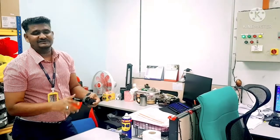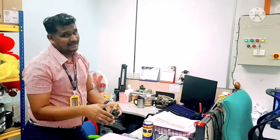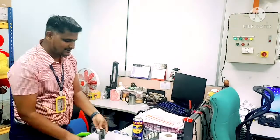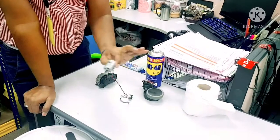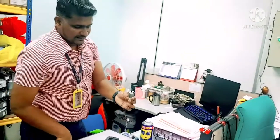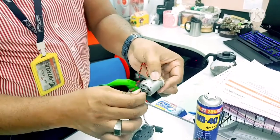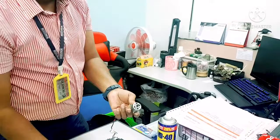Check whether the wheel can turn after removing debris. Sometimes the wheel totally cannot move even if you press harder — that's not a gear issue. If you turn the wheel and it feels very hard while the other side turns easily, it is also not a gear issue and not something tangled. In that case, it is usually because the motor inside has jammed. I'll show you here — all motors differ in size and capacity, but I'm giving a demonstration. Sometimes a small armature inside the motor touches the magnet and because of carbon powder or debris sticking there, it becomes jammed and very hard to turn.